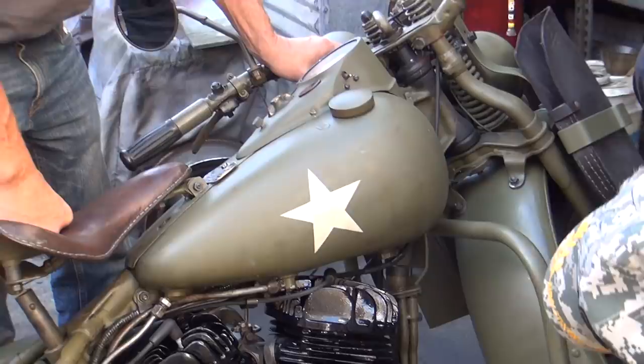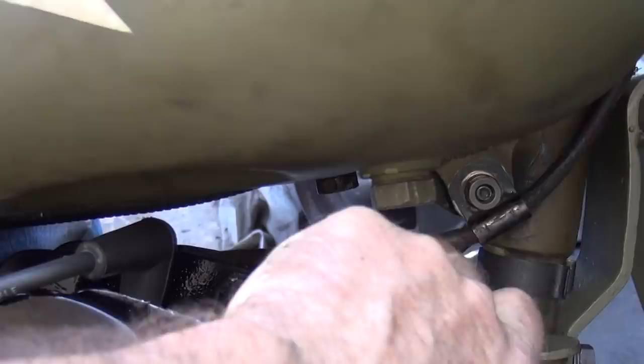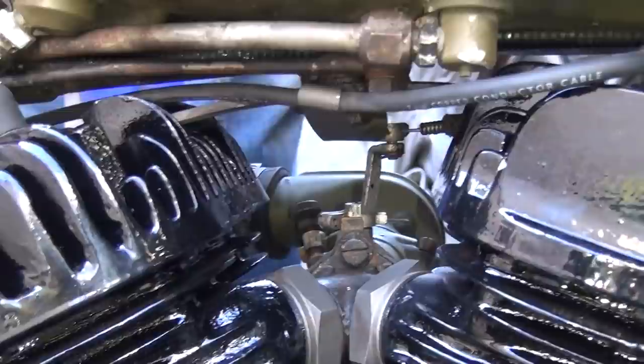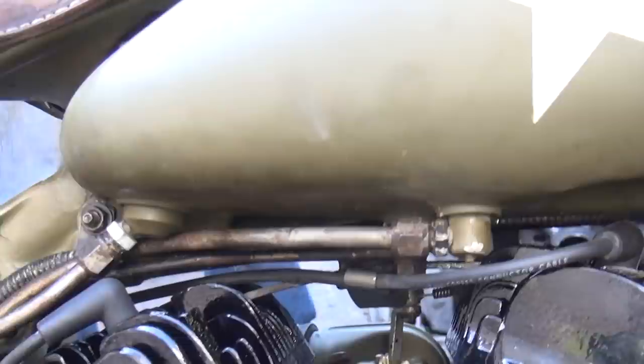We have a half inch to deal with, so you need to take this clamp loose. Okay. See how that bolt has two threads in it? That's not good either. Either it's loose or you need a longer bolt. This here needs to be moved down to about here, because that's all the inner cable we have left under there right now. Because it got shortened by 3 inches, because it was so long. So, right now the bike has a lot of problems. Inferior installation of some components, one of them anyway.